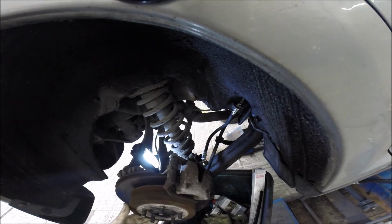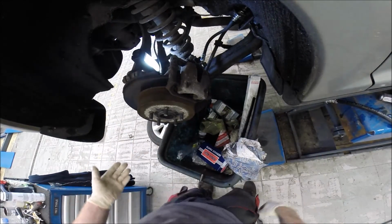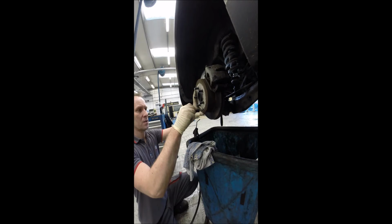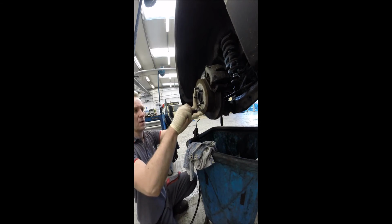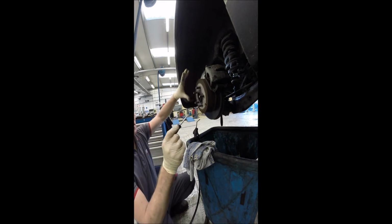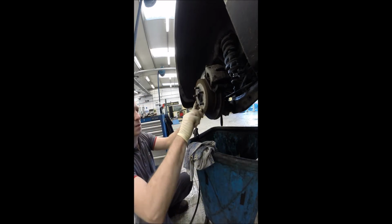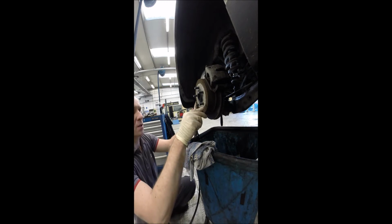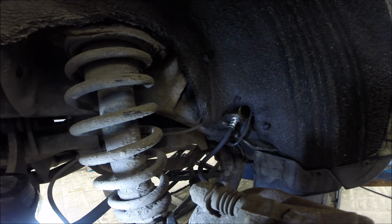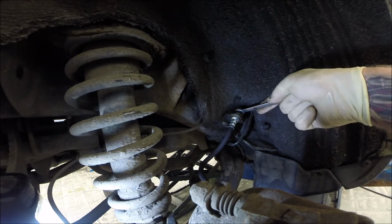Okay, if you have the rear suspension wheel out, it is a good idea to check the handbrake. So you have to just open this rubber, find the place inside by catching it with the screwdriver and adjust the handbrake. Okay, that's maximum 1, 2 in the back. Okay, that was fine. This is the adjuster for the brake shoes. Important. All right. Okay, double check how tight it is, the 10. Is okay.